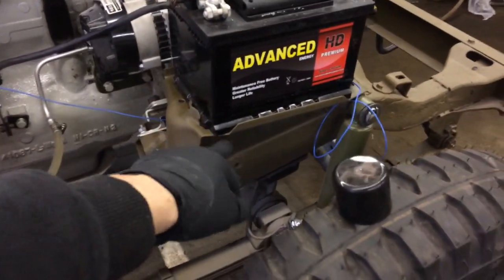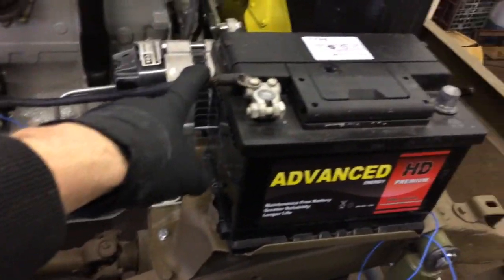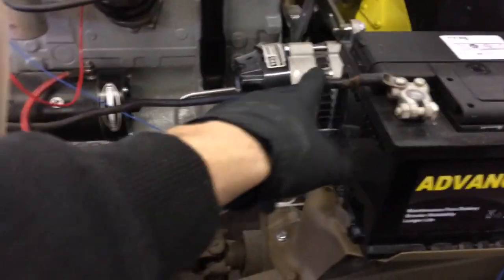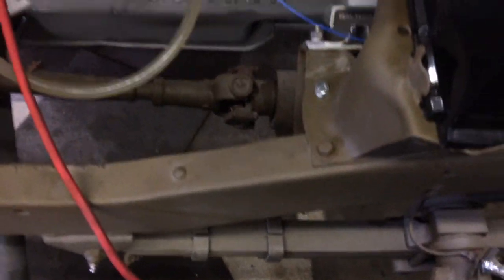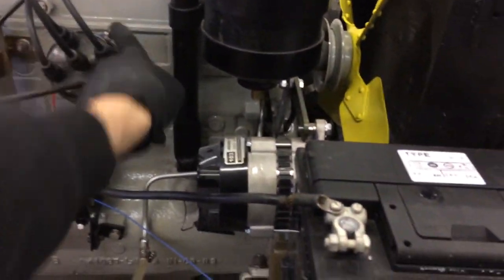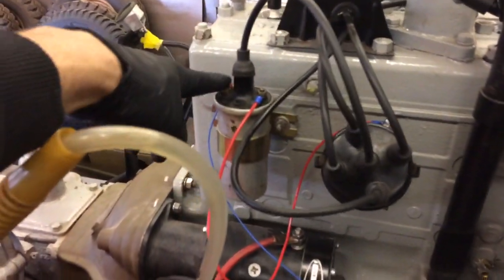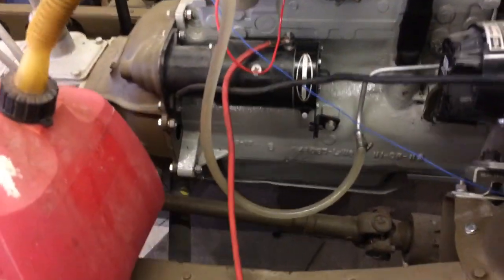So I put the battery plate on, which was a nightmare. It took me half an hour to put that on, 4 bolts, because the holes didn't quite match the centers. Anyhow, this is like a temporary connection, right? It goes onto Earth. The other one goes from the positive to the foot switch, which usually starts the Jeep, onto the starter motor, and then we've got the dizzy, with the negative onto the negative of the coil, and the positive of the coil going around and hitting the battery, at the same time as that one. That should be enough.